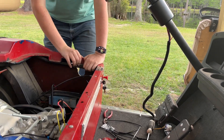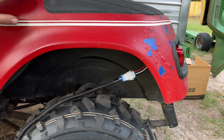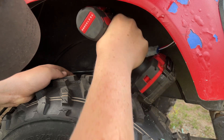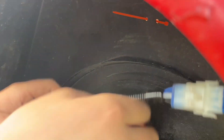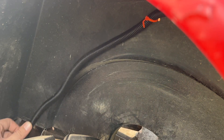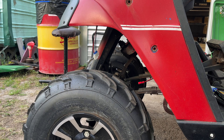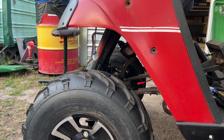I'm going to plug in the tail lights and see how much extra slack we have and where to zip tie it. To keep the tail light wiring harness from rubbing the tire, I'm going to drill two small holes in the plastic fender right here and run the wire through — that'll keep it from rubbing anything. I'll do another one down below and then do the same on the other side. Now that the tail lights are wired up, I'll continue pulling this harness underneath the cart loosely.